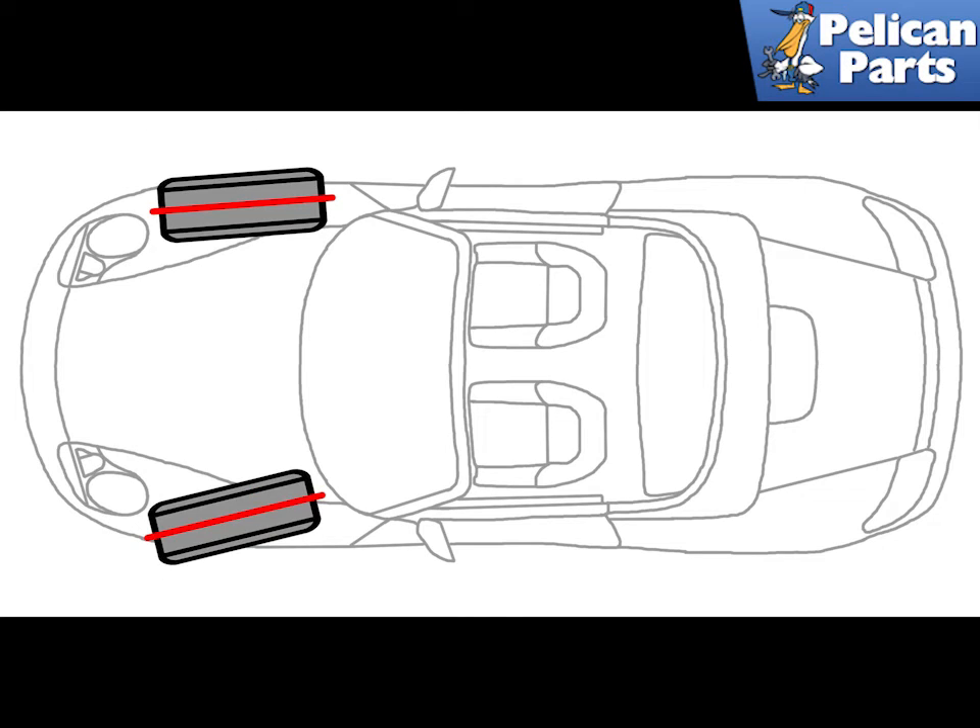Toe out through turns: when going around a corner the inner wheel will turn at a higher and tighter radius than the outer one, so that both wheels are able to turn around the same point without any tire wear. The outer wheel turns at an angle less sharp than the inner wheel. This minimizes the amount of scrub of the tires on the pavement as the car turns.